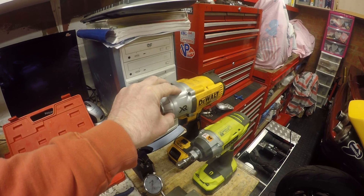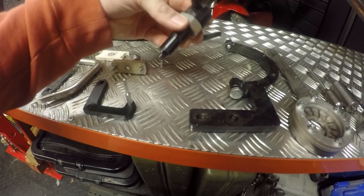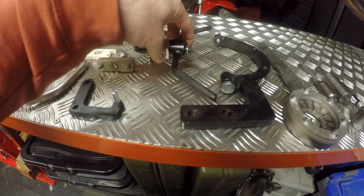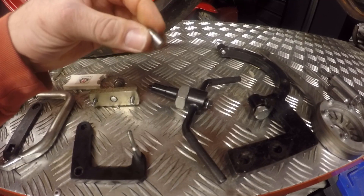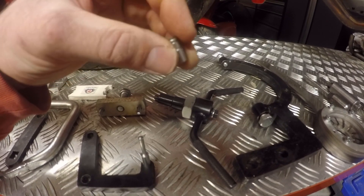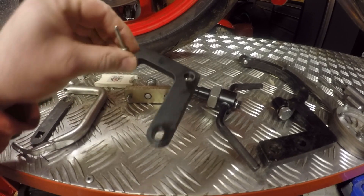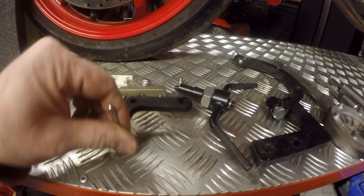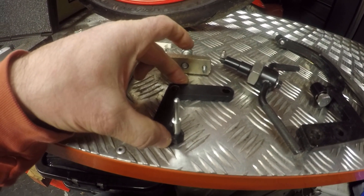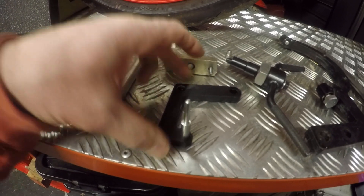You've got the engine turning tool — you can also put a timing disc on there so you can do engine timing. You've got your closing shim measurement tool which gives a known measurement to work from. And the gear selector tool — this is the official Ducati one — which makes your life a lot easier when you need to set up the selector fork into the selector drum on the drive pins.